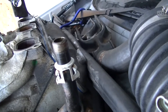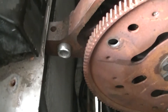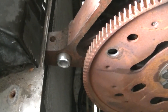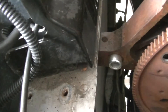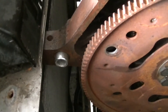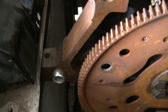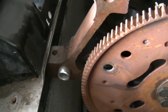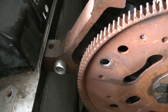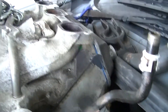Back here the valve cover is on the gasket but I don't think I've bent up any metal. The front boss for the transmission cleared the core support and we're about a quarter of an inch away from the radiator, so things are looking okay. It wouldn't be the worst thing to remove the radiator for absolute certainty, however we're gonna try to do it without because I think there's gonna be just enough room.